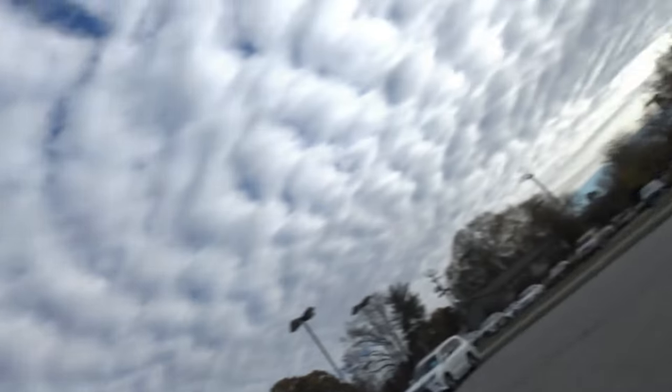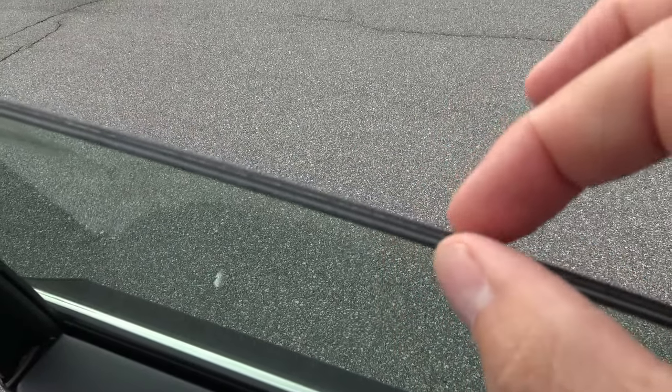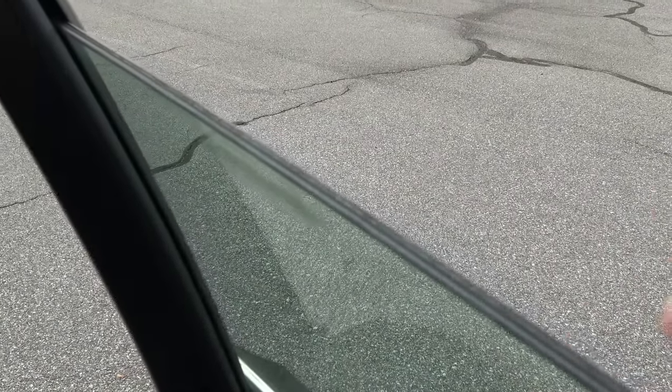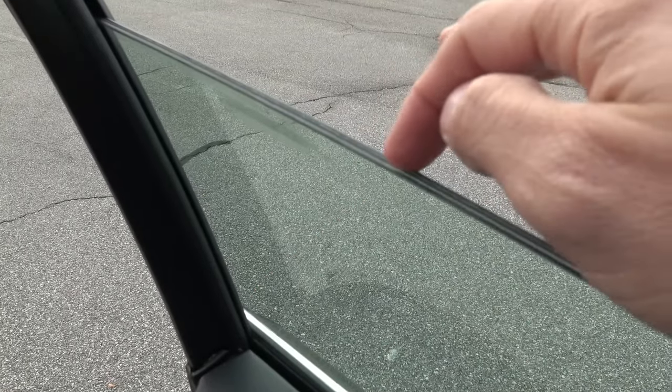That's another reason why these things are so whisper quiet. Let me show you this little trick — I'm going to press the button twice on the ignition to power the windows so we can roll the window down to see the top of the window. That is actually double pane glass, much thicker than a regular single pane in a regular vehicle. There's a ridge that runs along the top of this glass — that's sound dampening material. This is two pieces of glass with a laminate in between that acts as a sound dampening material, helping prevent wind noise while driving.